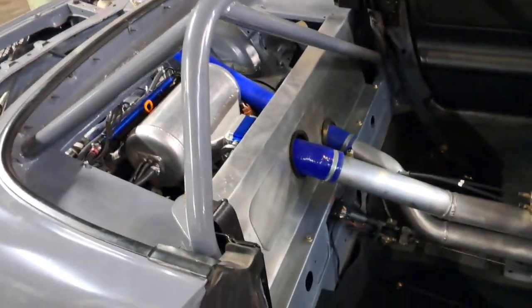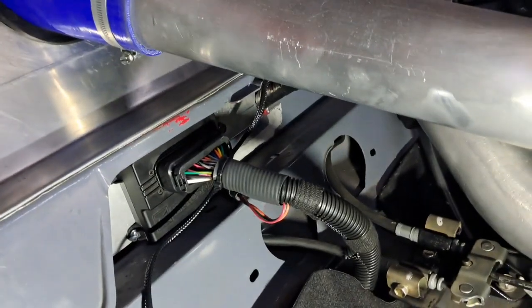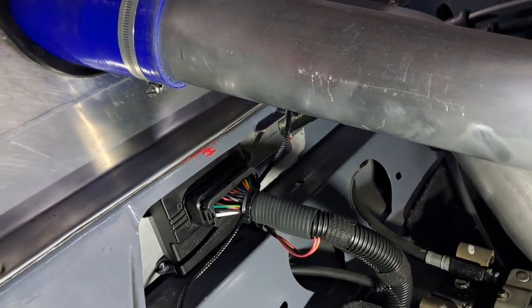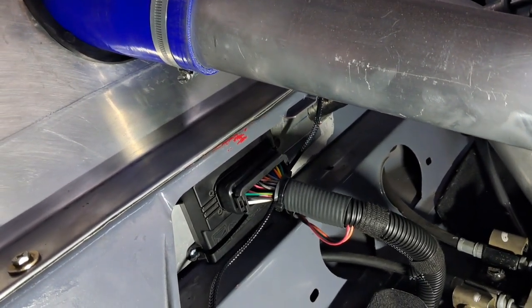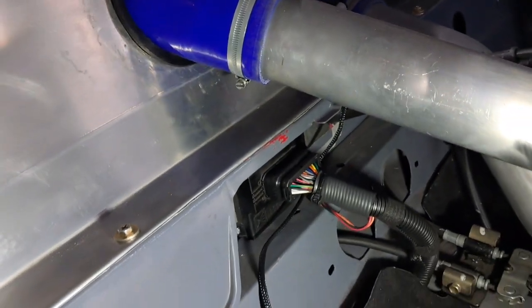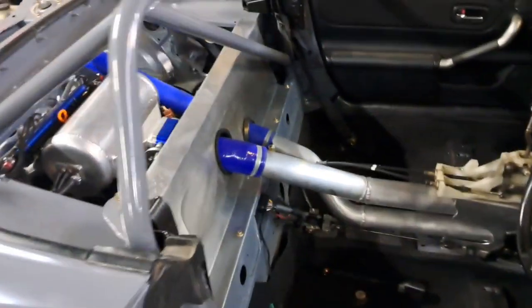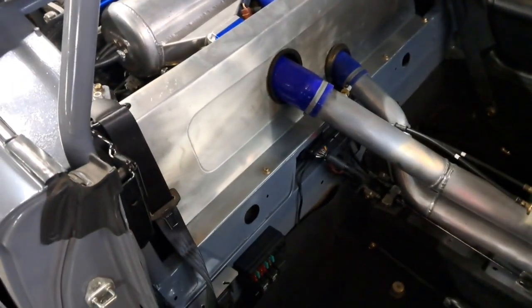So how did I fix that? I cut and shut the wiring — I've got an external MAP sensor now. What is that? That is a MicroSquirt that I've had sitting on the bench for about three years, never got around to using it. I wired it in — cut and shut, wired it in — and within 10 minutes of mucking around with some settings, it fired up. That is an absolutely virgin tune; I basically just got it to start and run at idle.